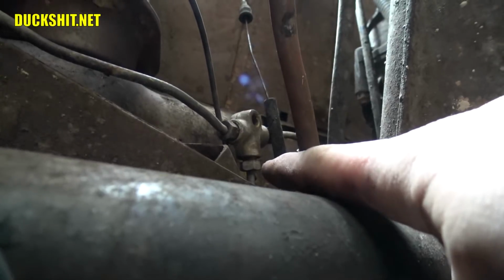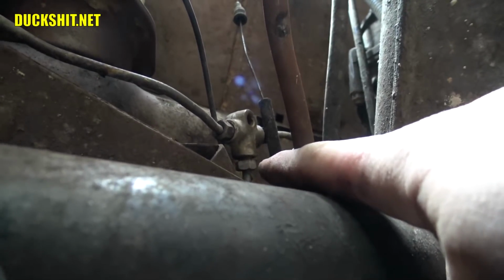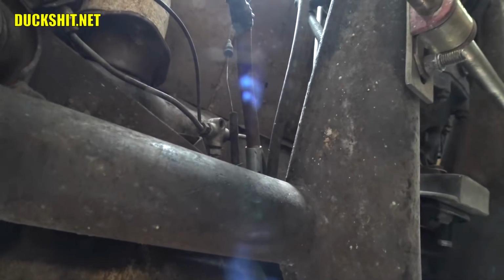The last thing that I forgot to do, which we haven't done yet, is I've got to remove the starter wire. And that's up on the opposite side over here. So let me get that off of there too. And, oh yes, the brake line, right there. I've got to loosen that one that attaches to the T. Once we've got that out, then I believe that subframe is officially freed from this body, and we should be able to drop it. Well, wish me the best.